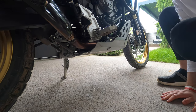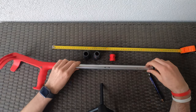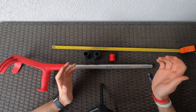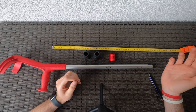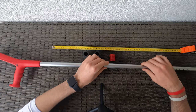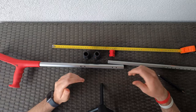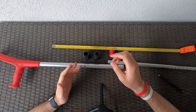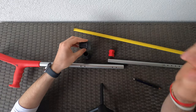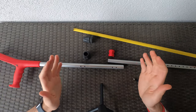I already made all the calculations and markings on the crutch. Ideally you want the trail stand at a maximum extension of 37 centimeters, but we'll make it 40 centimeters at full extension — just in case we're on uneven terrain or using it on another bike. We need about 8 centimeters of tubing left inside for stability, so that's 40 plus 8 = 48. Because we're going to have 2 centimeters of additional rubber on each side, we subtract another 2 from the total, giving 44 centimeters. Divided by 2, each tube has to be 22 centimeters.